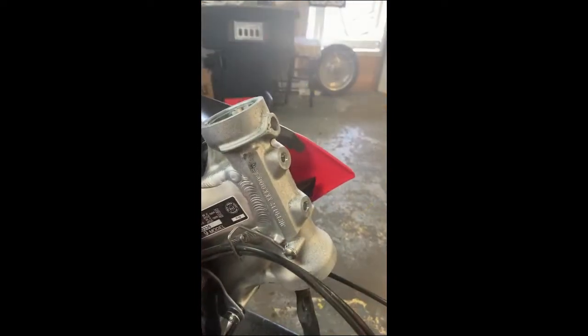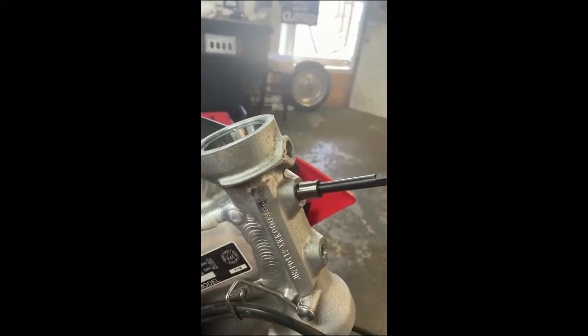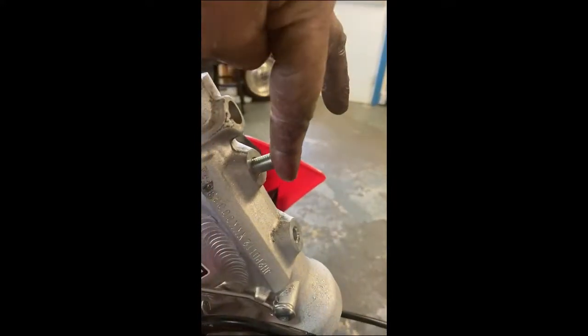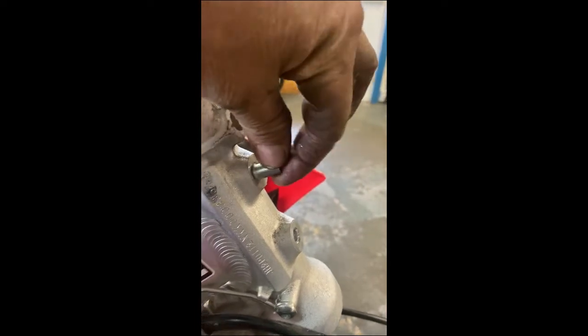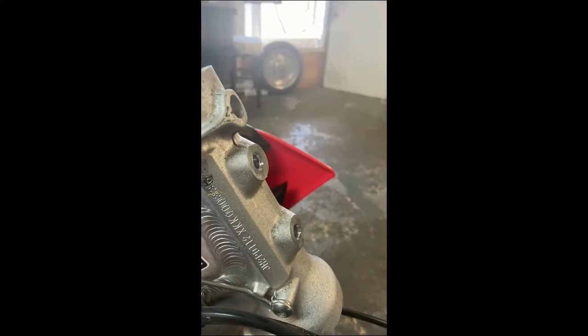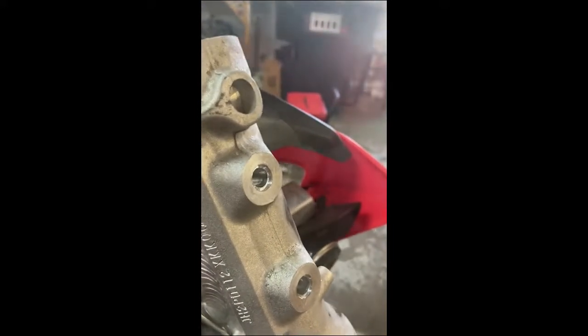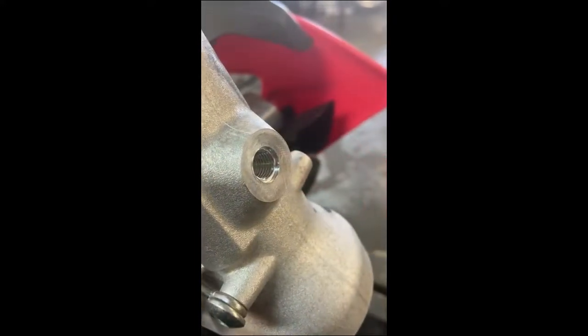That's all going to get cleaned. This is the tool you use — it's a countersinking drill bit that comes with the TimeSert, which allows this guy to actually sit flush. I've got it in upside down right now so you can see. That leaves us just threading the hole, and we'll thread that and get the insert installed. When it's fully prepared, it has threads to accept the barrel.